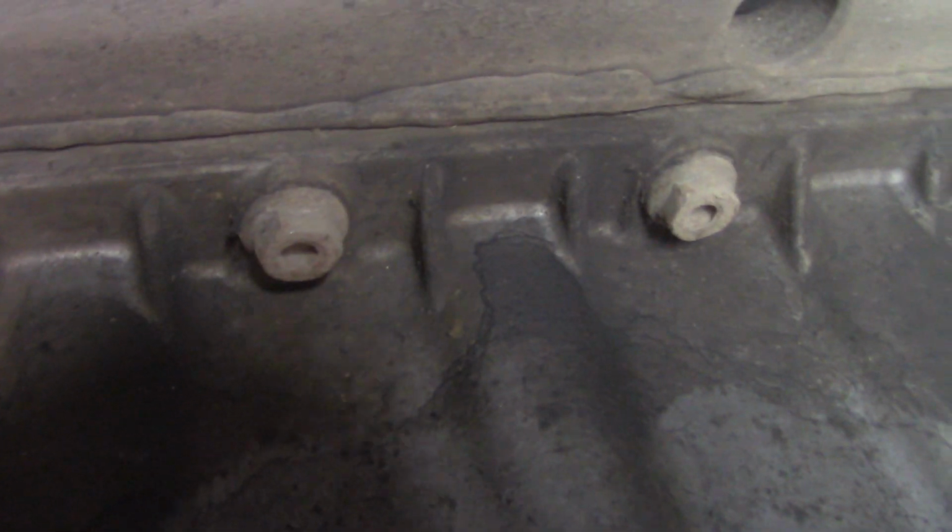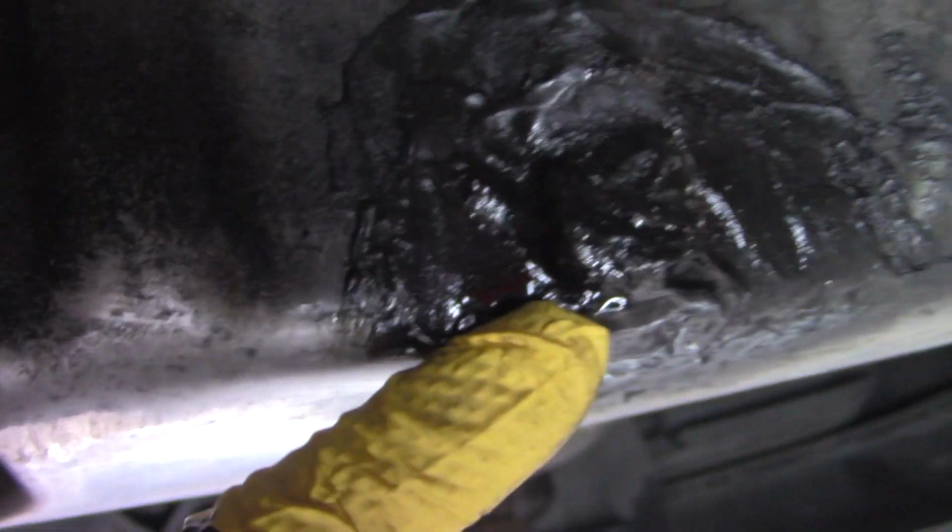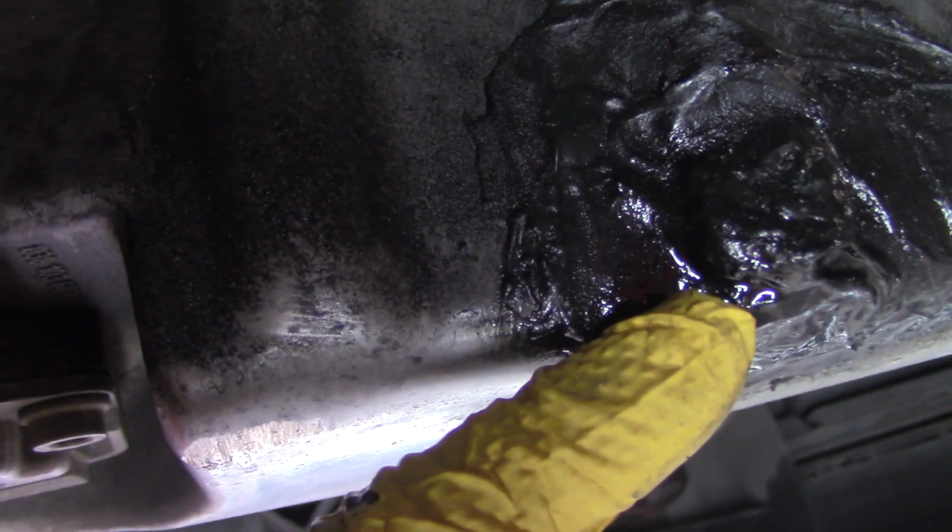We're going to have to remove 3 bolts along here and the usual bolts right round. There's 20 of these small 10mm bolts. There's a little small Allen key hole up in the middle of them as well, so we're going to need an Allen key. So we'll set the camera down. I'll dig this out and get a jar in underneath and we'll drain the oil out.